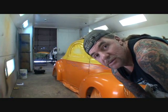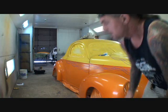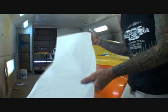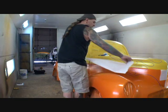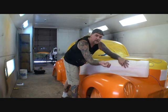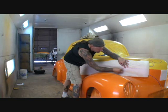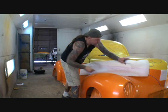I figured it wasn't really fair that I just kind of rushed this job through, because I know you're watching these videos to learn stuff. So, once again, we've got a pattern right here. What I did — I made a pounce pattern out of paper. I taped it on here just like this, and I got it on the other side. Then I took a crayon, the flat side of a crayon, and went ahead and traced out my pattern.